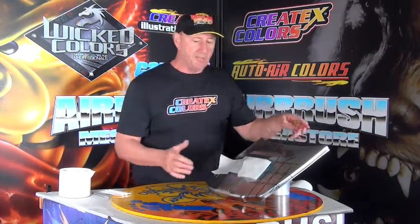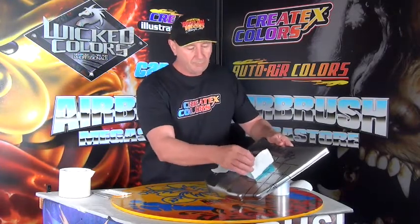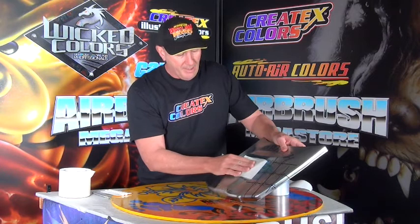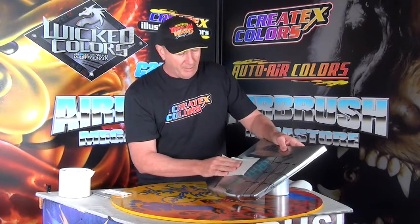So now I'll peel it off. This is where you guys run into trouble. You say it doesn't stick. Well, I'm going to prove to you it sticks, and it sticks easily. Okay, so there's nothing over the top of this Quicksilver, it's just Quicksilver. Now we don't pull our mask upright because we want to break the surface tension. So what we do is we pull it down along the edge. There again, we're only going slow. We don't want to go quick. It's not a race. You want to make sure it's all on there.